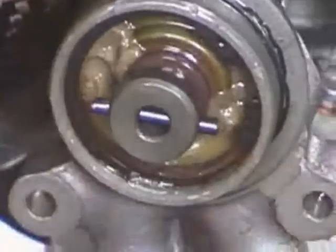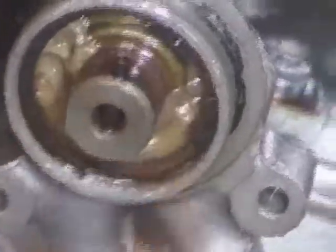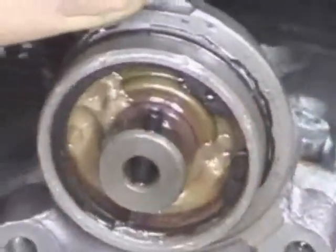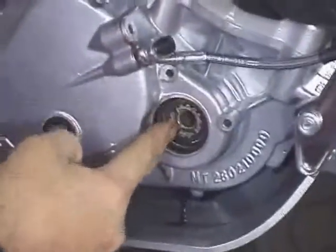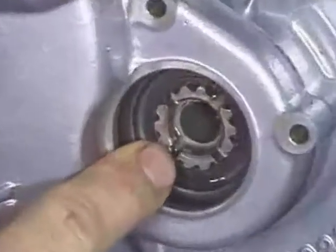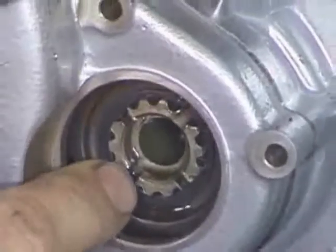To do maintenance to this device, you will remove the snap ring which is visible there on the interior and the components come out this way. This pin going through the shaft will fall into place in one of the two cutouts in the end of the crankshaft here. So when reinstalling this, be certain that you have proper alignment of this pin with the crank.